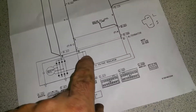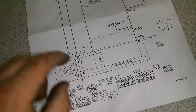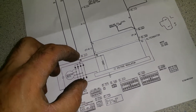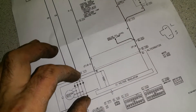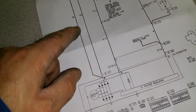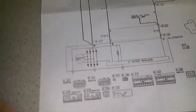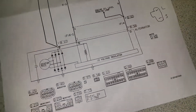This variable field produced by the rotor generates alternating current in the stator. The rectifier converts it: at the cathodes you get positive DC, and at the anodes you get negative, which is connected to ground. The output is pulsing DC, filtered a little by the capacitor. With eight diodes, the pulses are very fast, and because this voltage is pumped into the battery, the battery acts like a huge capacitor and smooths out the pulsing voltage.